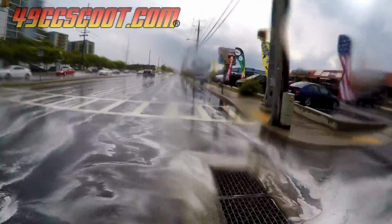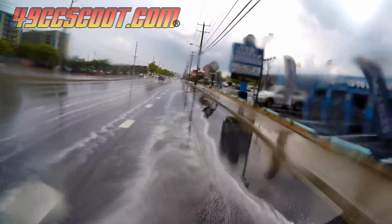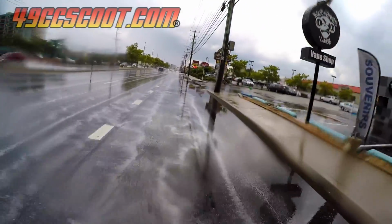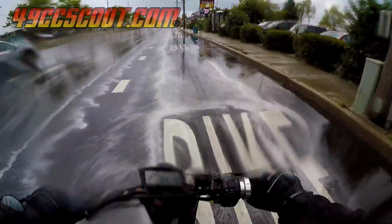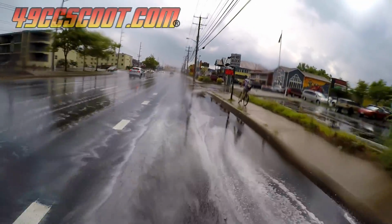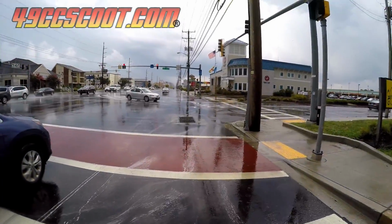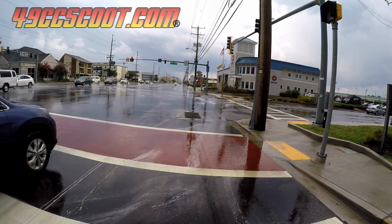I assumed that moisture was either causing ignition issues or getting into the airbox, but rather than sensibly going home, I decided to keep riding around and just revved a little instead of idling so it wouldn't cut out. That didn't last long because it started to bog on takeoff and I gave up and started heading back.